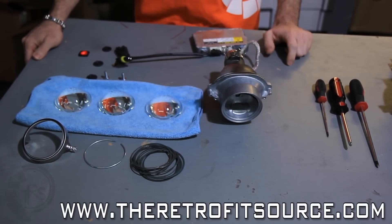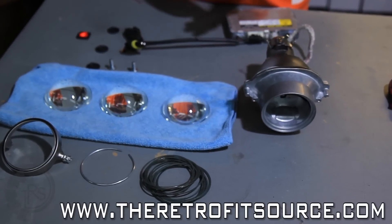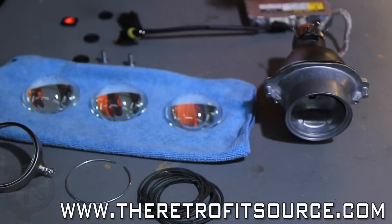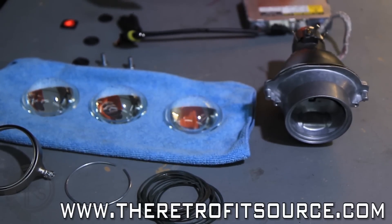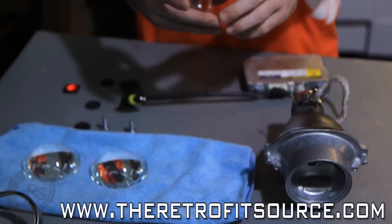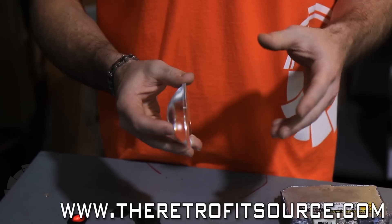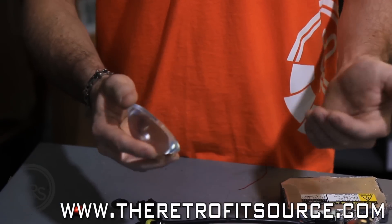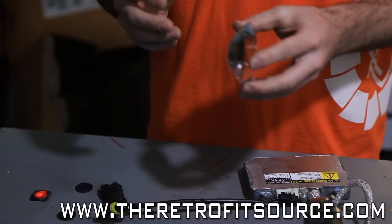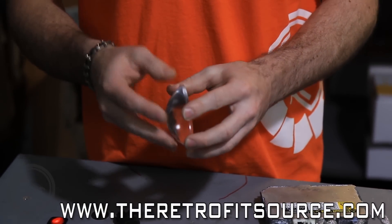It's a three-inch clear lens, but that's really not the end of the story because there are other three-inch lenses — like the Mazda 3 and ZKW-R, for example. Those will all fit, but the other thing to consider is the focus height of the lens, which is the depth of the lens from the front to the flat side on the back. That's really important because if you don't have the right focus height, you're never going to get a sharp and colorful beam pattern. When choosing a clear lens, it's important to get one that is not only the right diameter but also the right focus height.